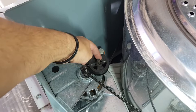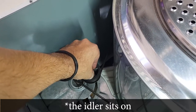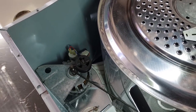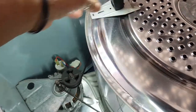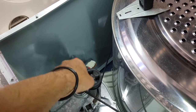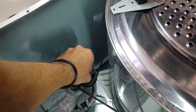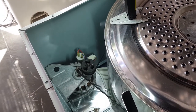Now, I am feeling just this shaft, the shaft that the bearing sits on. And if I had done anything with that, I would have cleaned this. It's a little bit grippy. And what happens over the years, just get some light down there, over the years dust gets in between where the bearing slips on and the shaft, and I think it just grinds away and makes like a paste or something, and it gets very grippy, and that can make problems down the line.